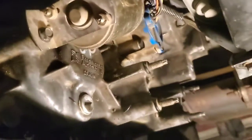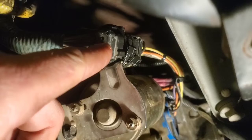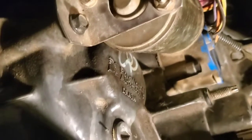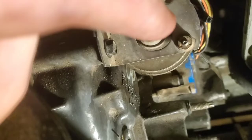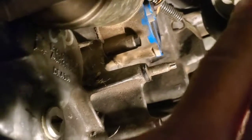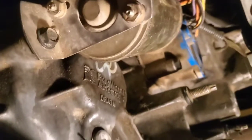Okay, so here's the rear axle and you come right up to the back of the transfer case — this is your actuator motor. You want to just unplug it right here. I've got it zip-tied in place now that everything is fixed. Your front speed sensor lives just right behind this. As soon as you move the actuator, there's a speed sensor back there that looks similar to the rear shaft speed sensor right here. The computer uses these two sensors to determine whether to engage four-wheel drive.